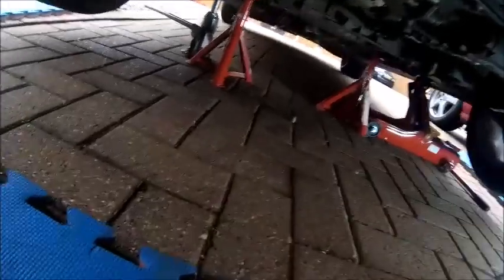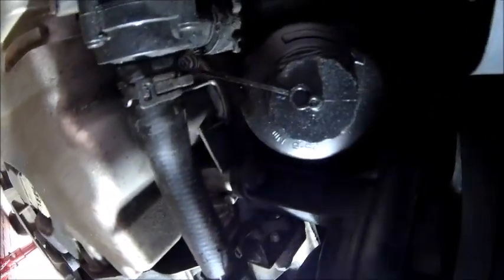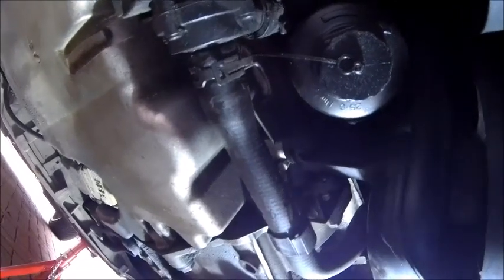As you can see, that's pretty easy. There's a bank of screws, I hope you can see this, down that side, and a bank of screws down that side as well, and then it just slips in to the front here. And when you've got that off, it uncovers this, which is where your oil filter is, and obviously at the back you've got the drain plug. So next job is to get the oil drained.